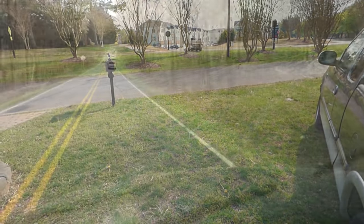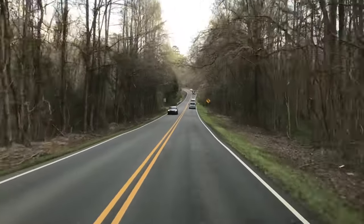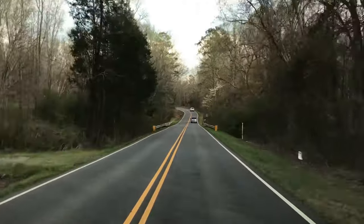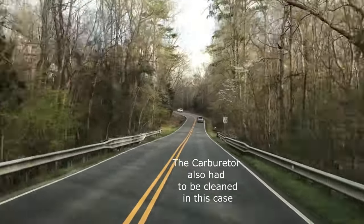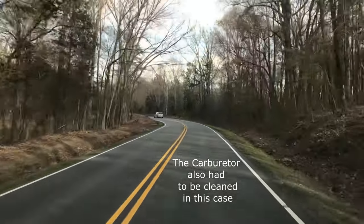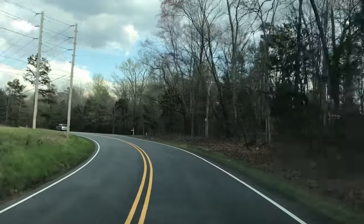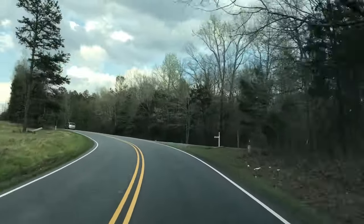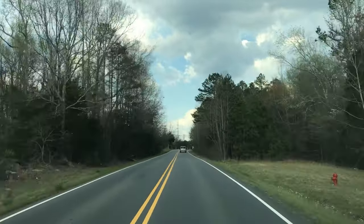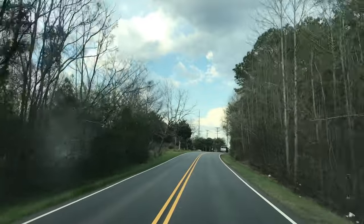All right. Well, that was a good lesson learned today. I really think the problem with that golf cart was water at the bottom of the fuel tank. The tank was almost full. Obviously, it picked up condensation over the winter with the hot and cold in the southeast here. And it was really hard to get at the tank and the fuel line down at the bottom. We drained, I guess, about a pint off. But I really think that was the problem.